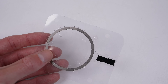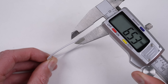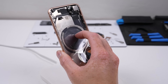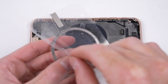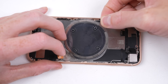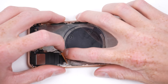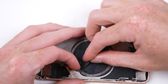It's now come time to add the MagSafe magnets. Apple's official magnets come in at 0.65mm thick, whereas an aftermarket ring is closer to a millimeter. Because the older iPhone lacks the larger cutout in the mid-frame to accommodate the magnets like an iPhone 12 would, we want the magnets as thin as possible to avoid issues when closing up the phone, as just a few millimeters can stop the phone from fitting back together properly. I'll trim off the alignment magnet, as without its recess it will lift up the battery even higher. In hindsight, I should have orientated the magnets with the opening accommodating the standoff, but I can just remove the one problematic magnet to allow the standoff to protrude.